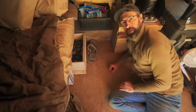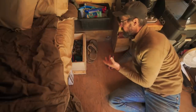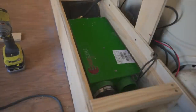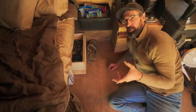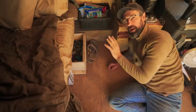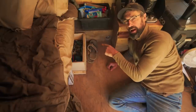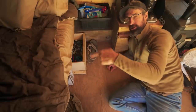I get asked a lot about how I heat the van - I have a Propex heater built into this box. The Propex works similar to the diesel heaters you may have seen, except it burns propane instead of diesel. The combustion happens in a separate chamber and is intaked and exhausted out of the van, so none of that stays inside. There's a heat exchanger that sucks air in and blows it out through this exhaust port - basically just air circulation through a heat exchanger, giving you really nice dry warm heat.